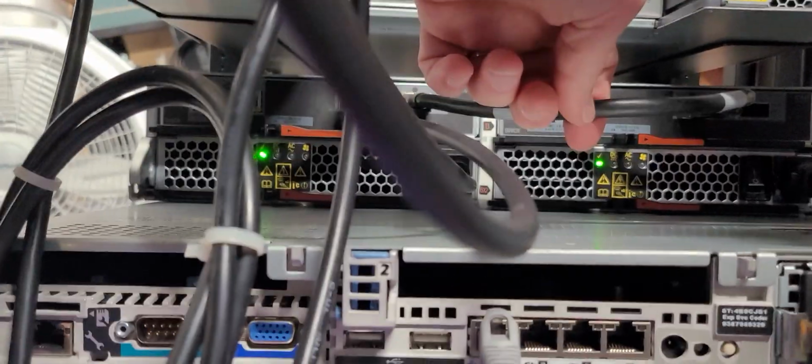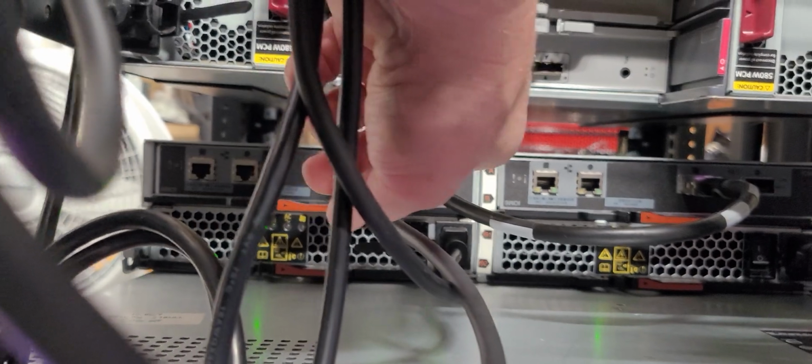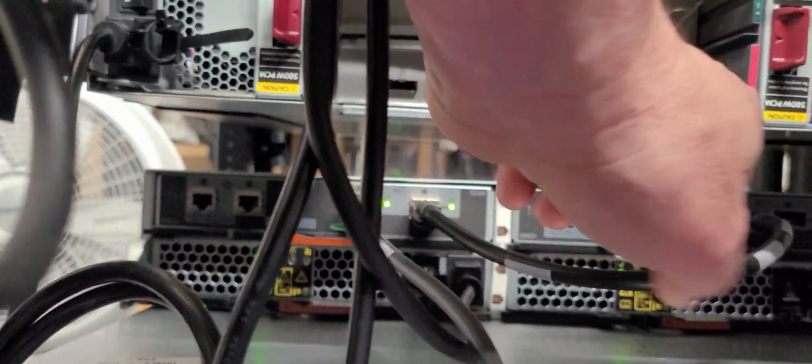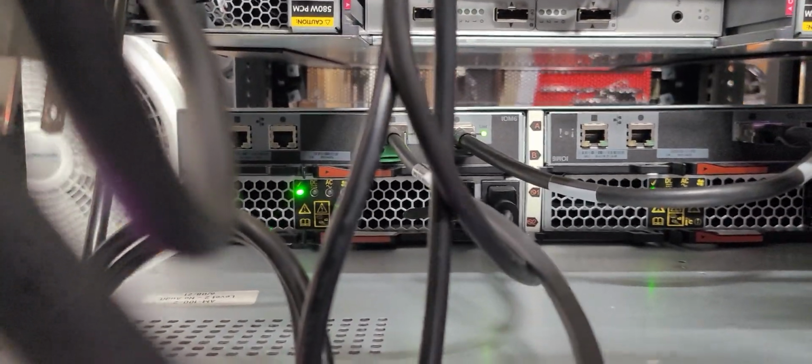It's hard to point it out to you at this angle, but this cable right here links your secondary controller to your primary controller, and that creates an alternate pathway. Now, if I wanted to go true full NetApp mode, I would run that other port over there on the far side up to a second controller, and I would have 2 sets of dual pathways. So this is where enterprise hardware is different than your store-bought home baseline hardware. Now let me explain.